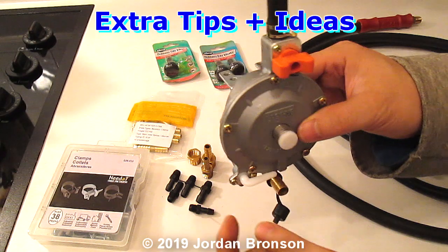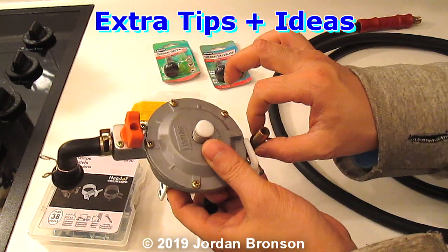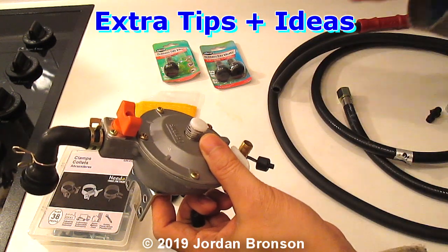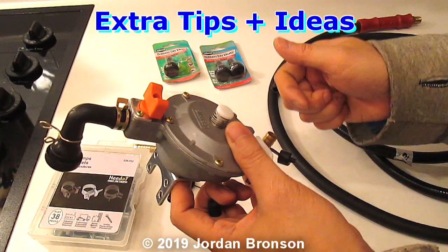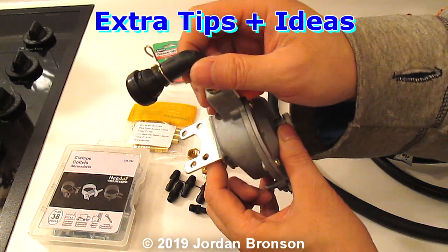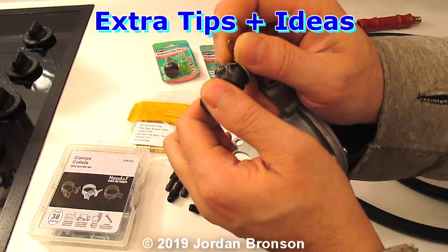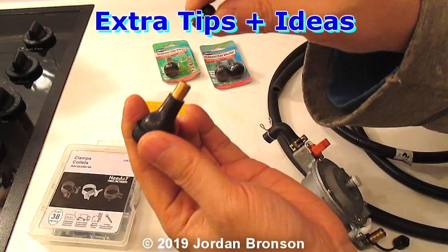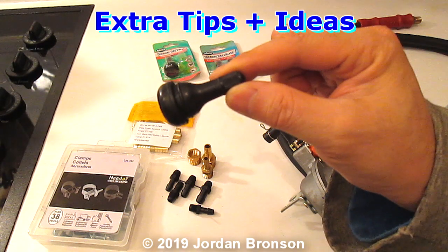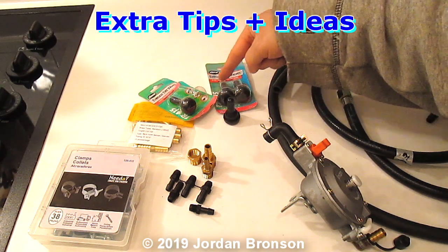Now, I'm going to give you an extra tip: never touch the end. Once you complete this, don't touch this end, because this end is going to your gas tank. You don't want it to open in, open out, open in, open out. It's best to go through here. Let's say you want to store it and you don't want a tank around. Let's say I'm on a pressure washer and I have to remove it. Just remove this. And then use your cap to close that up so there is no air or any debris going into your filter. Get it?